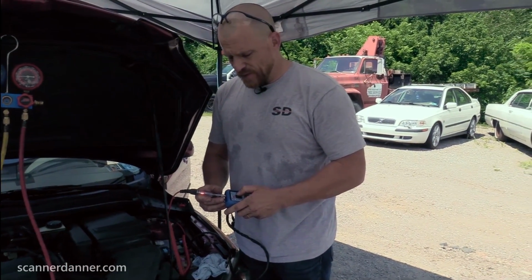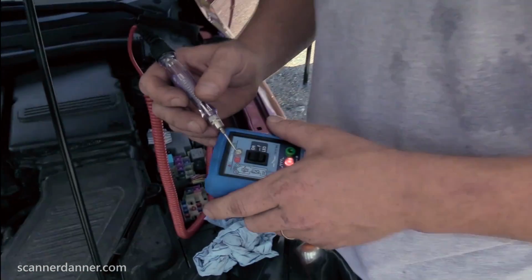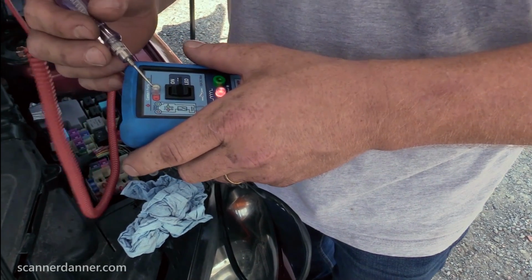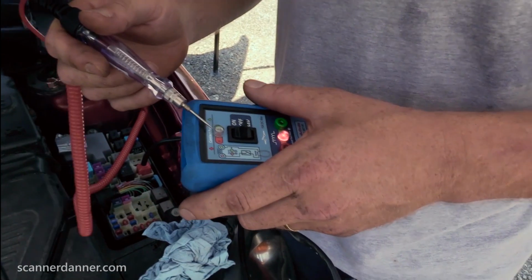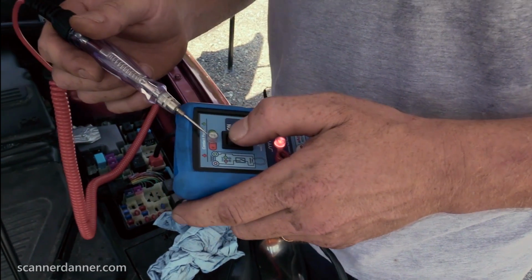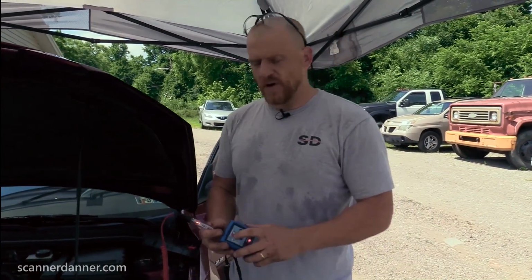And the other thing with this is telling me there's an open. I'm pretty sure that this bulb is wired for the load side contact, that if the circuit is intact, it'll find a ground through the winding of the clutch, and that light should be lit on the load side now. And I'm pretty sure. So is it the continuity to the... Continuity, yes. Yeah, we've done this like with fuel pump circuits. Yeah. I apologize. There's certain aspects of this light on the load side that I have questions on. Doesn't change how I'm going to approach the diagnosis.